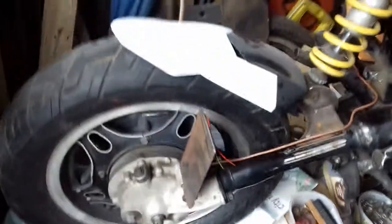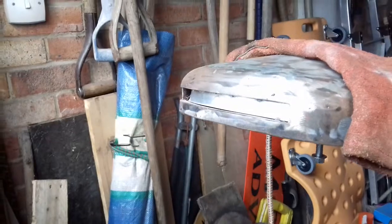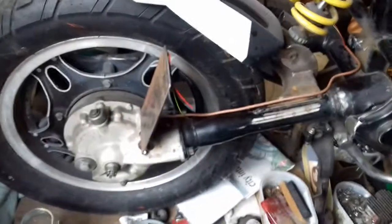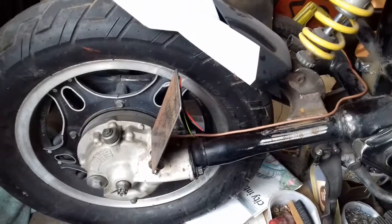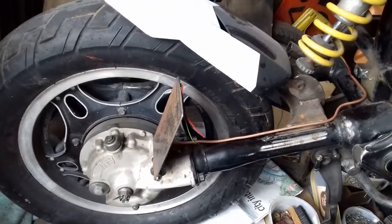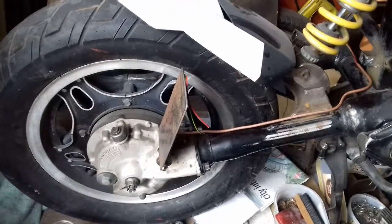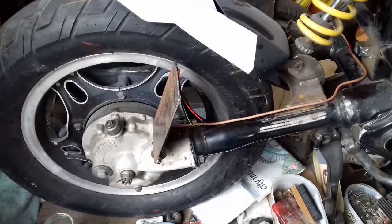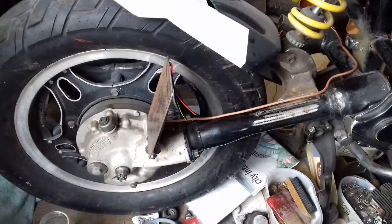Hopefully I can get away with having my new LED tail light in there, if I've got the right one. Because I remember saying that the MOT requirement is it's got to be a separate stop and tail light with indicators - it can't be a full tail light which cuts back to indicators. I'll have to see, because I won't know what I've got until I get it wired up, as it was one of those cheap Japanese or Chinese indicator units.